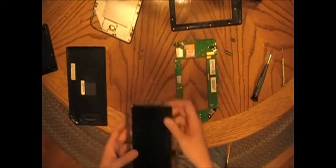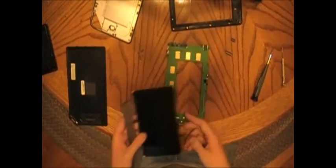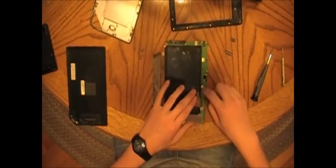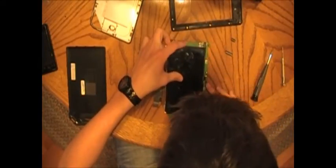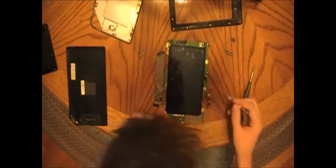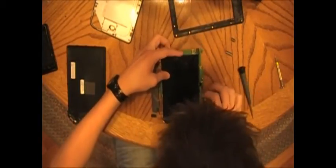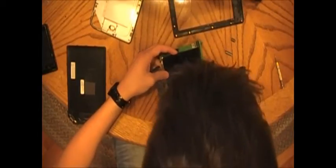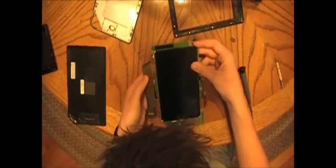Let's start with putting the LCD back onto the motherboard. Have it facing the side where you see these 6 shiny gold things. Slide these 2 silver connectors — silver screw holes, whatever you want to call them — under that wire. Make sure everything, especially the connectors on each side, lines up perfectly or you're not going to be able to get it back together. Once you get it set, it kind of stays.